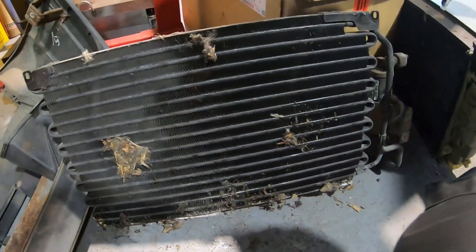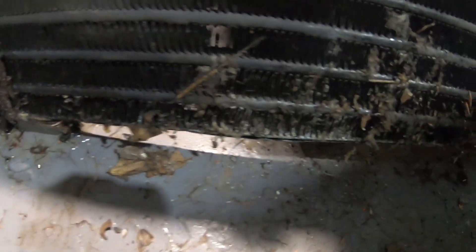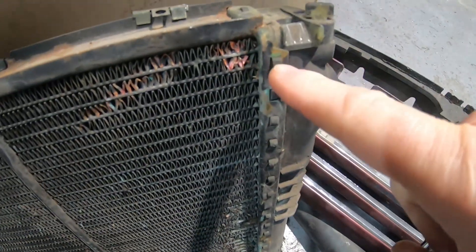The condenser has a hole in it - when I gassed it up it hissed horrifically. It doesn't look too bad; it obviously had some impact, I'm assuming birds, and some fins have seen better days. However the condenser I ordered was the wrong one so I've got a new one coming. While it was out I noticed my radiator has also seen better days - lots of signs of leakage down the bottom, and there's bits of orange which I think is K-Seal, similar to Steel Seal but with metal particles that block holes in cooling systems. It wasn't leaking at the time, but with fins missing, let's just replace it - it's not a massive expense.